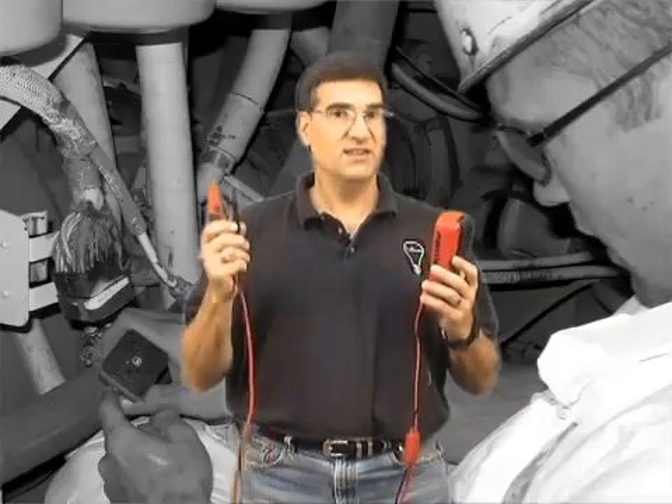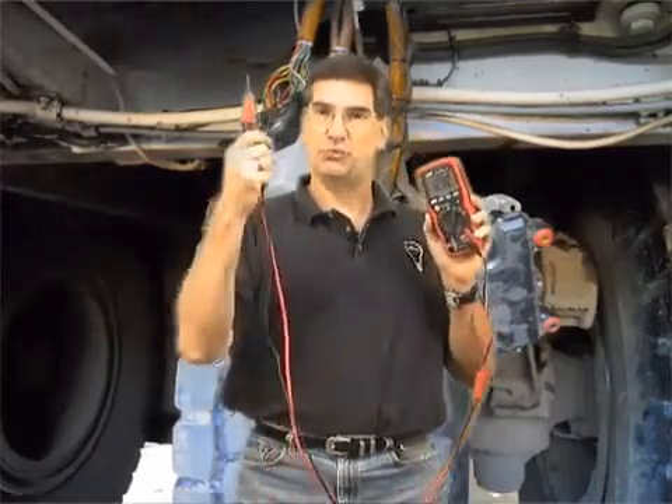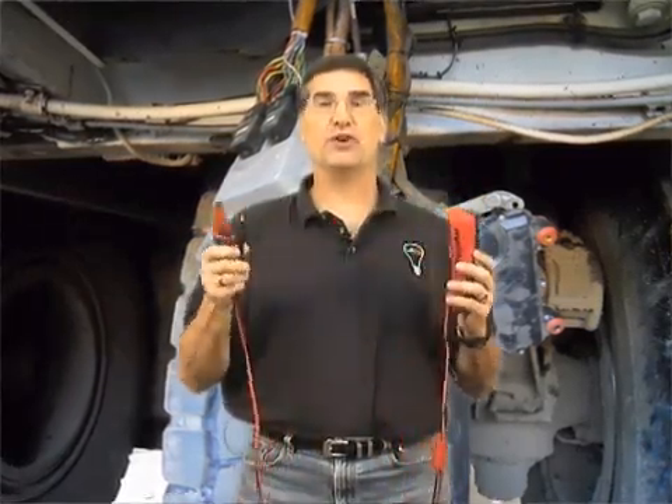Three faults: open, short to ground, high resistance. If you read system voltage loaded, then that means you don't have a harness problem. Let me repeat that because it bears repeating. If you read voltage with these leads and you see system voltage when you do, and you push this button and nothing happens, you just proved that there's no fault in the wiring harness.